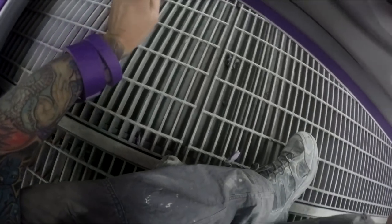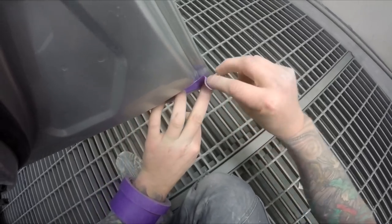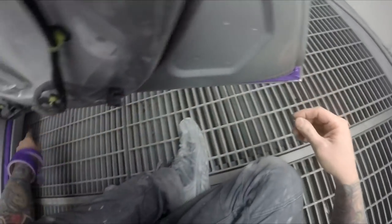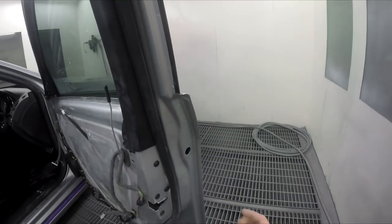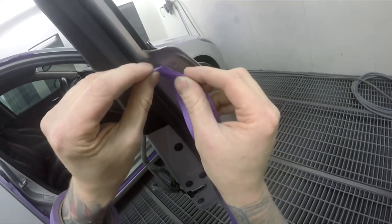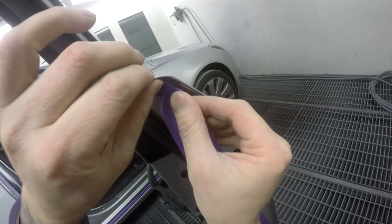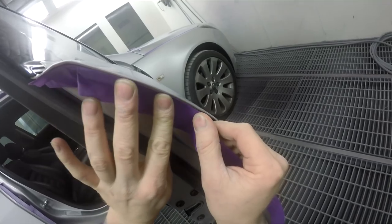Again, there's a bit of tape down the bottom here right on that sealer line. I usually run one strip up on there under here. And where you've got that little bit of sealer that's wiped in, I'll do a little bit of a false edge there just so you don't get a hard edge — because the sealer doesn't have a sharp line to it.